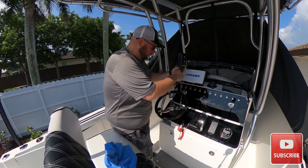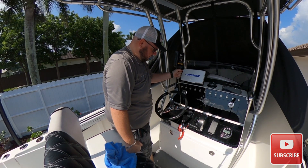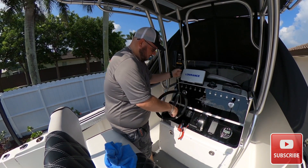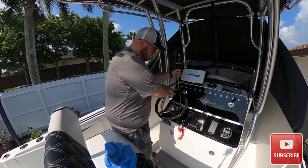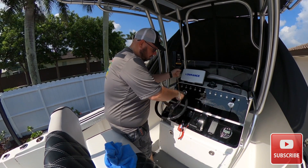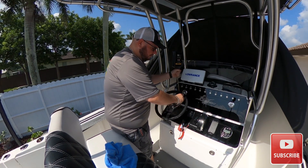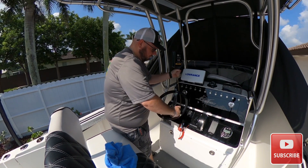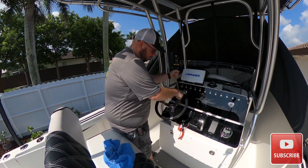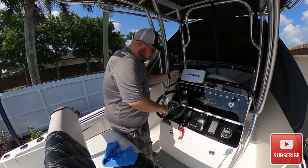I'm going to allow that to go into the pump first. A couple of turns clockwise, then you just want to change the direction — turn it counterclockwise, allowing all those air bubbles to come out. It's not a hard job, it just takes its time. Have patience with it. It's always best to also have a rag handy in case you have any oil spilled, so you can clean it up right away.